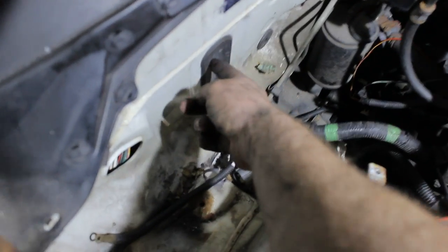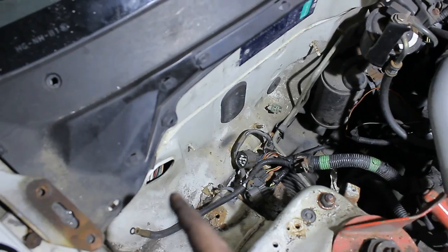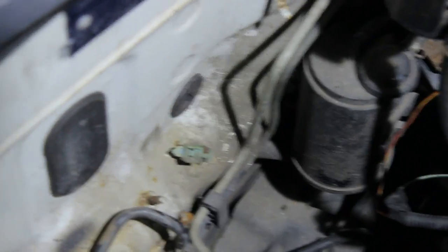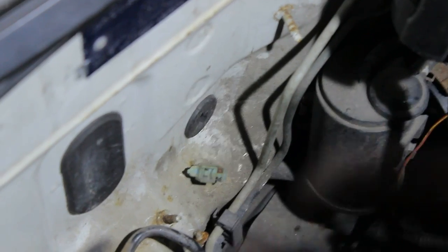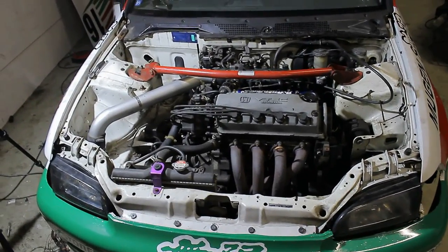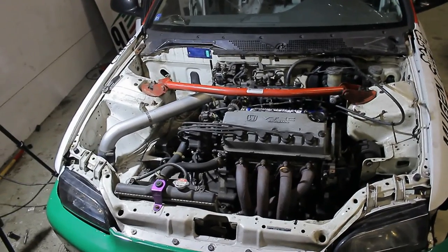The only thing left on that side is the wiring that goes to the headlights. For this side I'll use this hole right here — I'll make small cuts mainly because that's the furthest it can go, and that way the connectors are still inside the firewall. There is another hole — that little hole right there — but the only way you can use that is by either cutting the wires, which I can't recommend because it's your engine loom, or by de-pinning each plug and forcing everything in, then re-pinning everything inside the firewall. But the only way to do that properly is with the dashboard removed. So that's a possibility without making a custom wire loom, but the easiest option is definitely to go for this one.